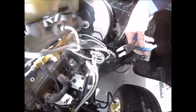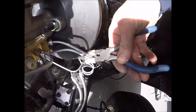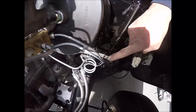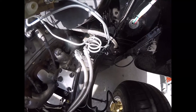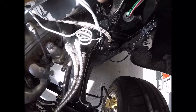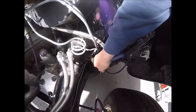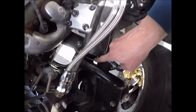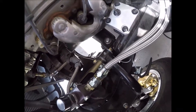This one I haven't done yet - just got lucky right up here, this looks pretty decent. I'll do it all the way down this corner piece. Here's my rear line - I've got my little coil around here. People ask why that is - it's supposed to take up the stress on the line going to the body mount and the frame, there's a little bit of cushion with body mounts in between, so it takes up that little wiggle room. You can see all my other lines coming from the front, left and right, way down in the corner. Driver's side looks nice with neat easy bends. Obviously keep it away from heat or any moving parts.